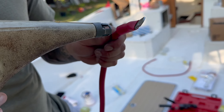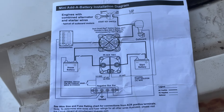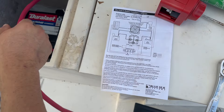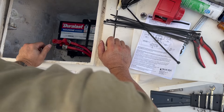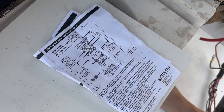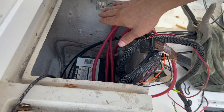We just installed the starter battery cable that goes to the main switch up here. Now this is our second wire on the house battery side — this wire is going to run up to the main switch. We're going to fish the house battery cable through here, cut it off around here, and leave it until we're ready to install the whole bracket with the ACR and the switch.